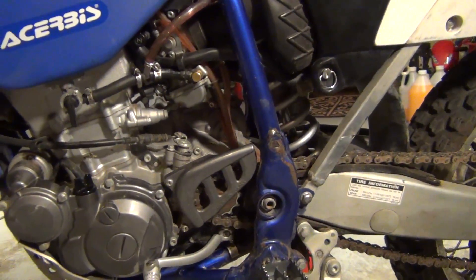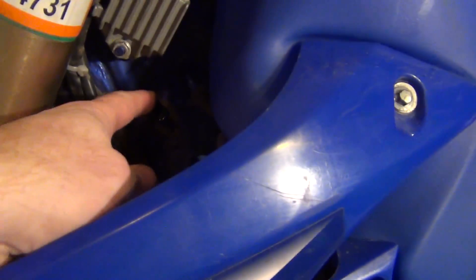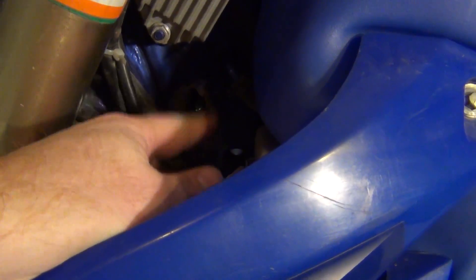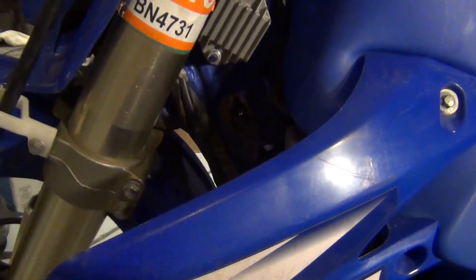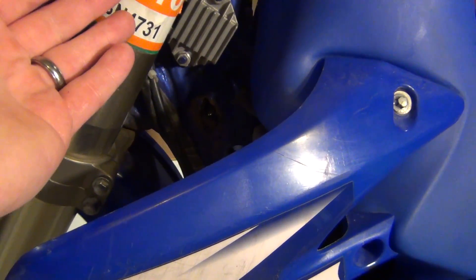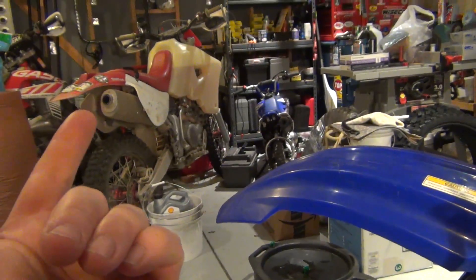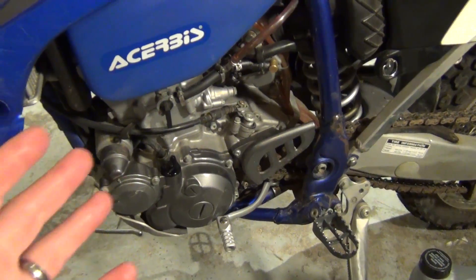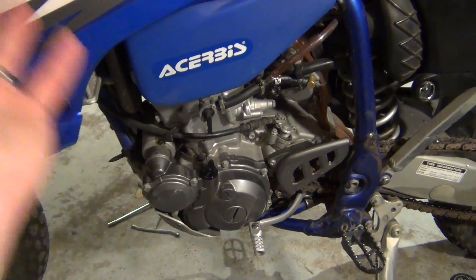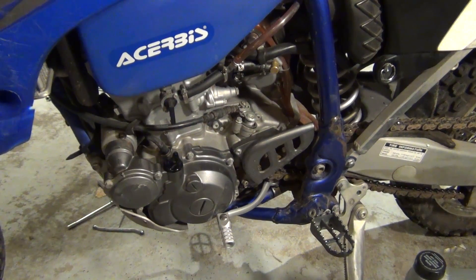There we have it - all done and ready to start. Check the oil: remember on this bike you let it warm up and then you check the oil up here with the little dipstick. Let it run for about 10 minutes until the bike's warm, until the oil has basically cycled through. The frame of this bike will keep some of the oil - a lot of bikes do that; the DRZ 400 and my XR 650R for example. You're going to be checking the oil up here because it's mainly going to be up there. It's not going to be down below unless the bike is cold - then gravity has worked it all down. Please like, subscribe, and keep following along. Have a good one, bye!